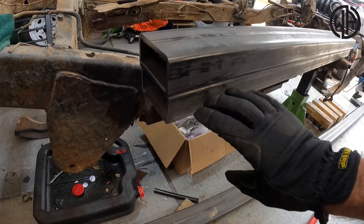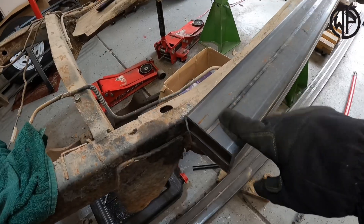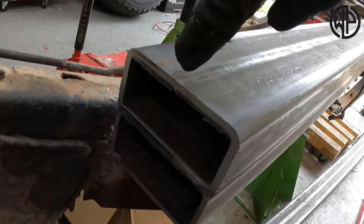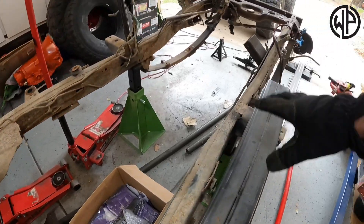I got two pieces of steel now cut to the exact same length. This steel is two-inch by four-inch rectangular tube with a three-sixteenths wall — much thicker than the factory stuff. It's also the stuff that they make all the aftermarket frames out of. I'm just saving about $4,000 by building it myself here in the garage with the tools that I have. It's obviously going to take me a little bit more time, but I also get to build it the way I want rather than just getting a factory reproduction frame — make mine a little wider, things like that. Even the stretch — factory reproduction frame wouldn't give you that.